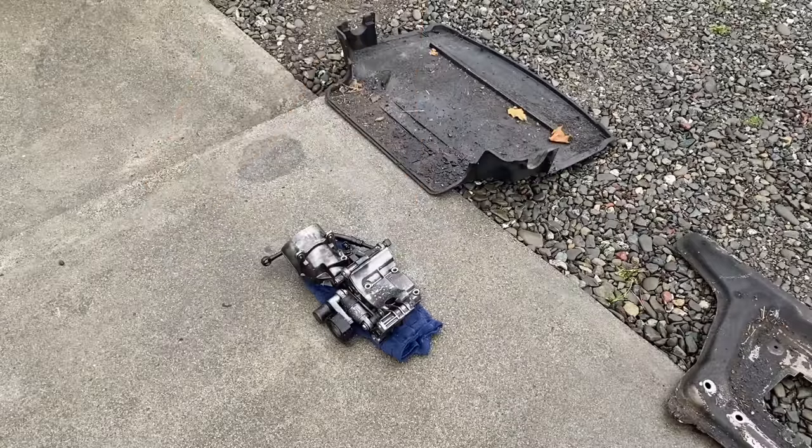Got the O-ring picked out. I'm just going to clean up this base — it's got a lot of carbon buildup. Then we can install this DISA. It's a little tight. I'm a little concerned but we'll see. That bell crank can go back in. It feels a little tight — it sticks when I actuate it. I feel like the tolerances are a little bit too tight, so I might take this off and shave this down a little bit. It's sort of catching up here at the tip, so I'm going to shave down the crank and shave this down a skosh. Let's test fit it with the bell crank and see how it does then.